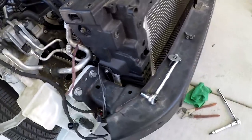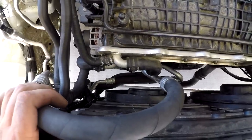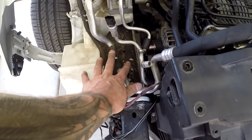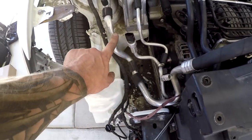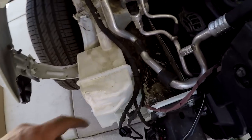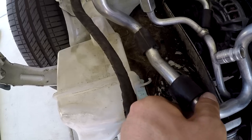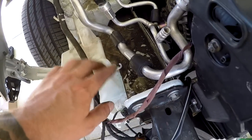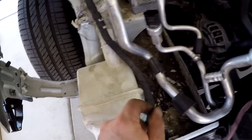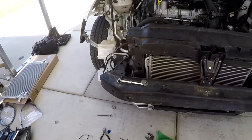It's going to sit below the headlight, clear the hood, and connects up nicely here — wrapping around without doing anything funny — and everything will be clearing the fan. I did have to take the headlight out to get the AC lines below the headlight line, where they're supposed to be. There's a shape in the frame supposed to keep it below the headlight. I don't want to try bending it too much to get it back in there, so this is going to be close enough without touching anything or risking a leak.